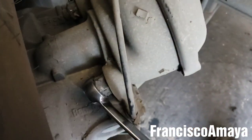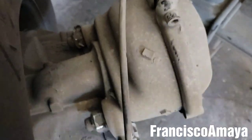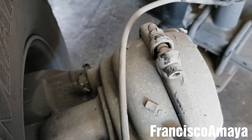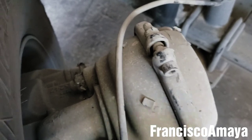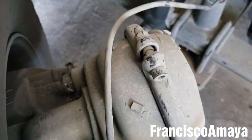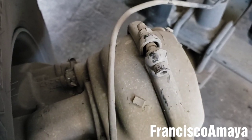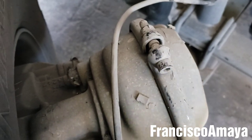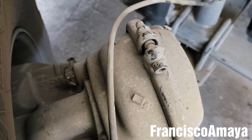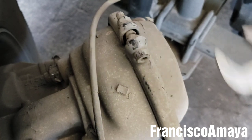So now I'm just gonna remove the bolts completely, the nuts completely. In this case, this brake chamber has no pressure at all because it's the front brake — this is a service brake only. If you have a parking brake, in the case of the rears, they're gonna have pressure. So you have to release the brake, press the yellow valve to release the pressure from the brake chamber, remove the bolts, then remove the brake chamber, pull the brake, and then the rod is going to get out, and then you disconnect the hose.